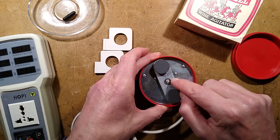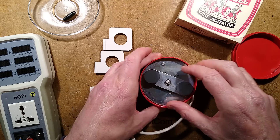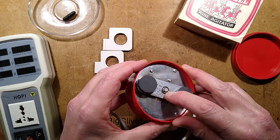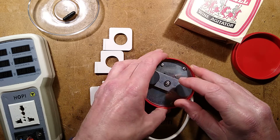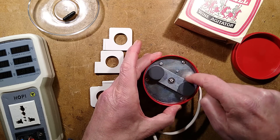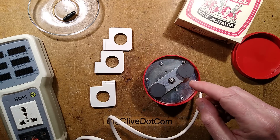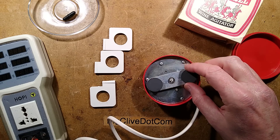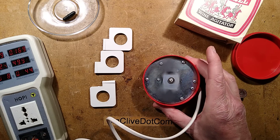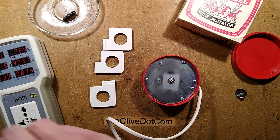So we've seen the power consumption. This little clutch is basically just a couple of grip washers and one of those little push-on clippy rings that are very hard to get off because they really bite into the plastic. The idea is it's loose on the shaft, which means that when starting up with these synchronous motors - they don't like a heavy load - it gives a sort of soft ramp up until it reaches speed. I don't know if it just keeps slipping all the time though.